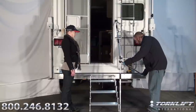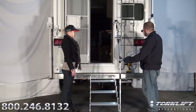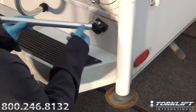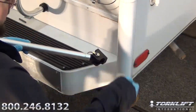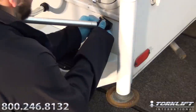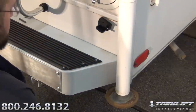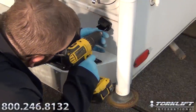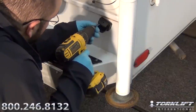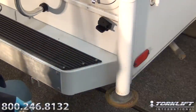Find a comfortable position for the strut arm tubing clip. As you can see, we have a heavy duty bumper and kick panel, so we have a couple different options for mounting. As long as you have a solid structure, you can really go anywhere, but for today's application we'll be going to the kick panel. After determining the location for your strut arm tubing clip, remove the double back sticky tape cover and place it against the location desired. You will then remove your clip and swing the strut arm out of the way. Next you will drill your holes and install your screws.